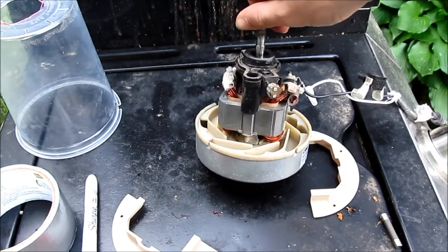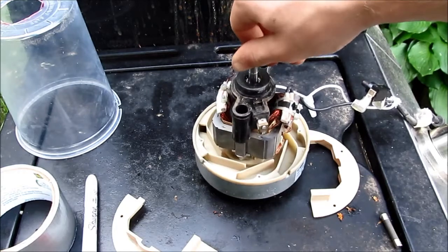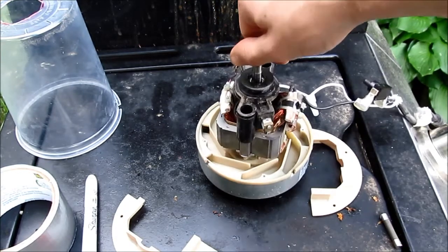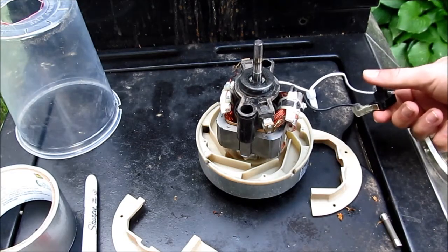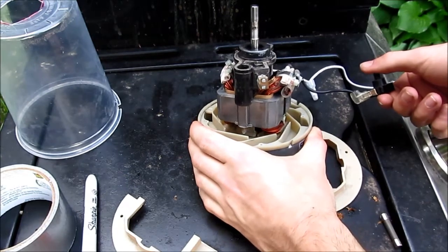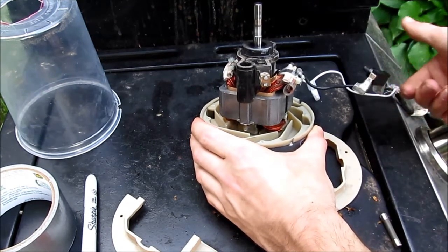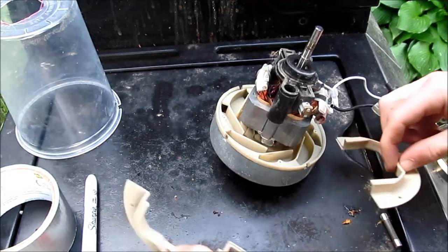This is a nominally 120-volt AC powered vacuum cleaner motor — full-size vacuum — that I grabbed from the scrapyard. This one works. I currently have it connected to 24 volts DC, which these universal motors will run on with no problem. That can still move a fair bit of air, even at a fifth of its rated voltage.